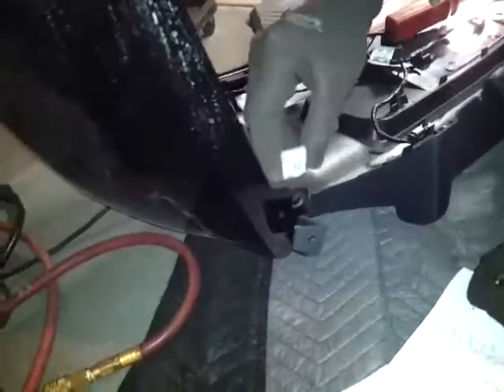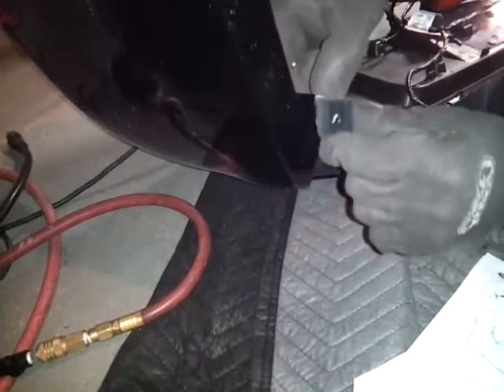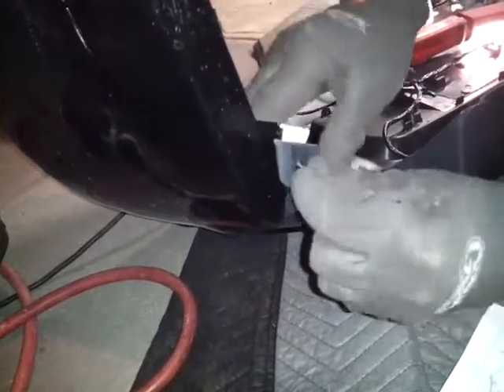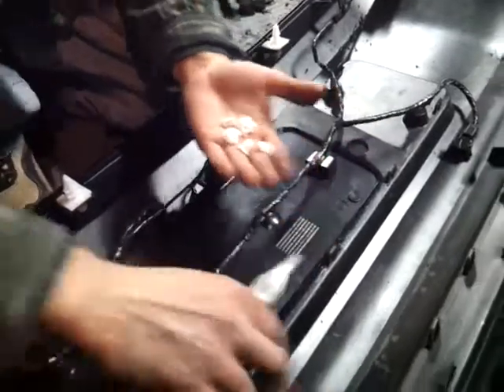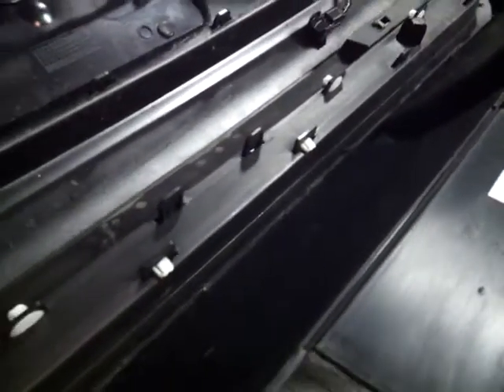Next step: you get two of these clips and these go on the actual bumper itself. This piece goes on the inside and you just align that — align the holes just like that when you're putting it back in. Do the same thing on the other side. Now you have six clips and these go where these tabs are — you can see they're empty in the middle, there's a hole. Just slide them in from the bottom. If they're hard to go in, just push from the outside so the tabs come out a little more, and you can use pliers to persuade them in.